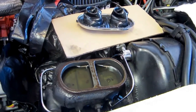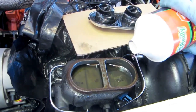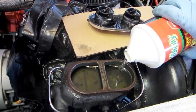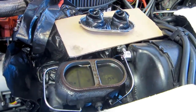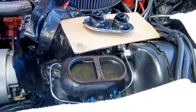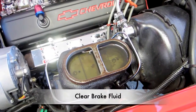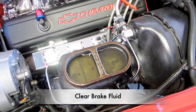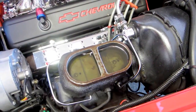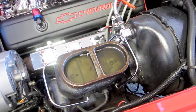I'll go ahead and top off the master cylinder. And now the brakes are done. Notice how clear the brake fluid is — that's a good indication that the brake fluid has been properly purged. No smoky, no water, just clear brake fluid in the reservoir.